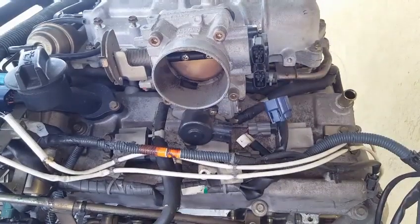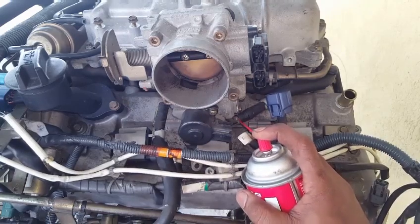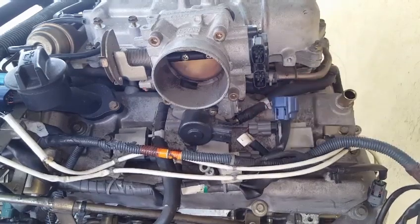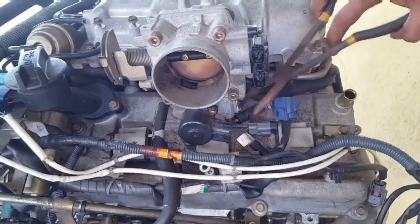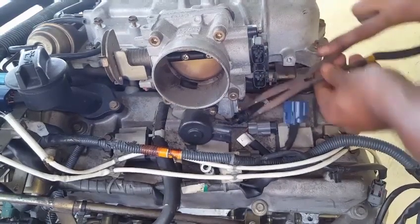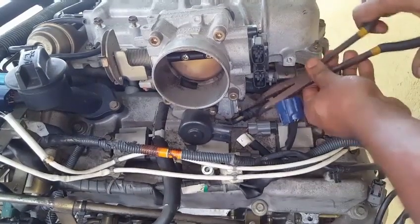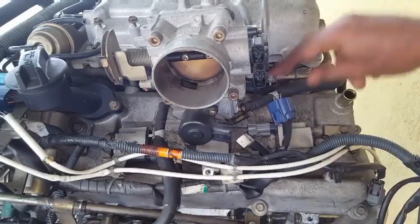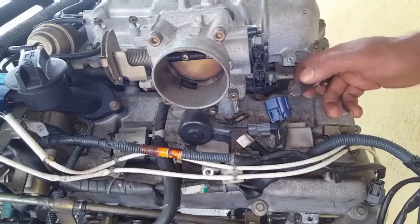Here we can see the hoses will become difficult to remove since they have aged onto the fixture. The best way to get at it is simply applying some lube at its connection, playing with that hose, making sure it does not become punctured by the tool. Puncturing of the hose is one of the most misleading things to happen during the course of your mechanic endeavor. When that hose becomes punctured, if it should be a vacuum hose, it will make the engine run or operate most improperly. So you must make sure the hose is not damaged by the tool.